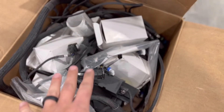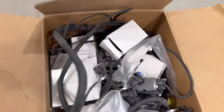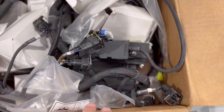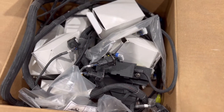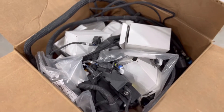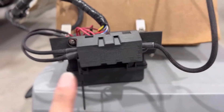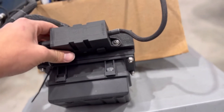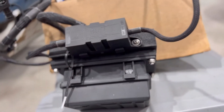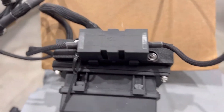What we're going to do is take everything out of here — especially the receipt for O'Reilly's — and we're going to lay this harness out and kind of get everything spread so we know exactly what goes where, and then we'll start running everything through. This is going to be our main relay box along with our fuse. I believe there's a 100 or 120 amp fuse in there, and this is going to be set pretty close to the battery.